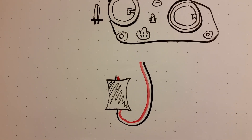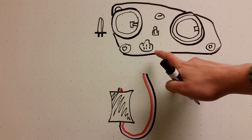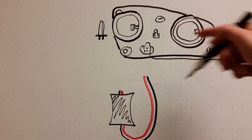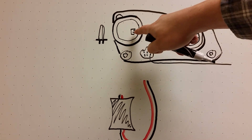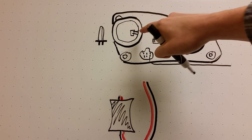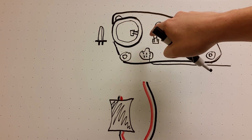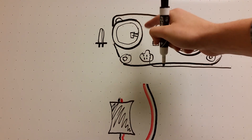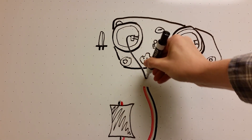I just wanted to break into the wiring for the HID. You do not need an electrical engineering degree or license to make this work. This is the plug coming into the back of the headlight assembly — it is 12 volts and comes in off of a wire loom. There is a plug on the inside of this headlight socket. You'll pull this headlight socket off; there are two sides and unfortunately they're not marked positive or negative. The negative side of the terminal is the one with two wires going into it; the positive side is the one with one wire going into it. You will be running wire down from the headlight assembly into the ballast.